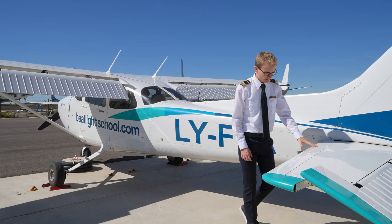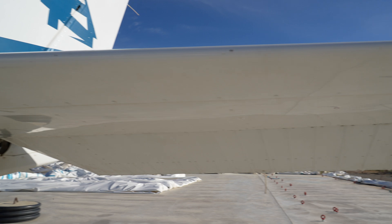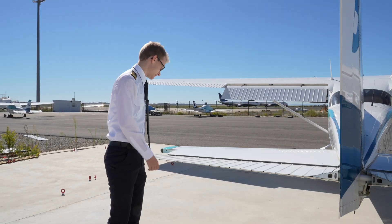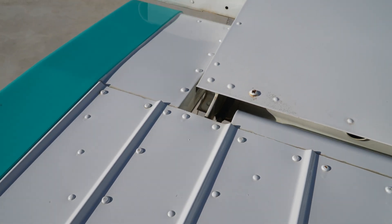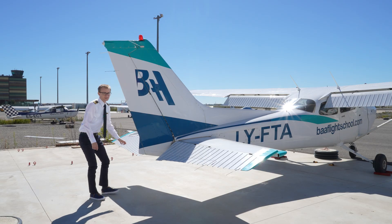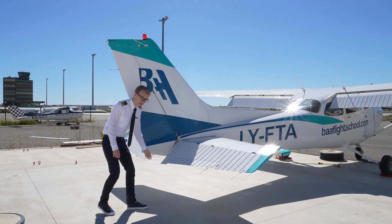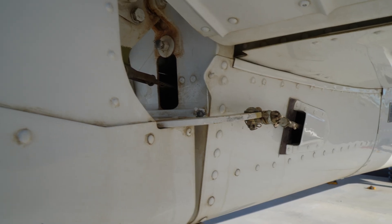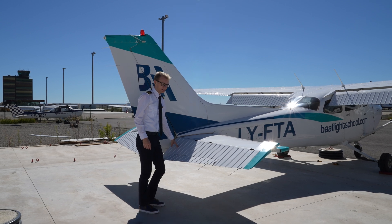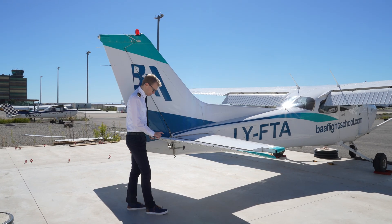We move along and take a look at the upper and lower part of the fuselage, checking for any general damage. We then move along to the horizontal stabilizer, checking both the leading edge, the upper surface, and the lower surface for any signs of damage. We continue on to the elevator, verifying that it moves freely and is securely attached, that the hinges all look good, and also taking a look at the control cable. Next up, we take a look at our vertical stabilizer and rudder, making sure it's securely attached and moves freely, and again checking our control cables. Then on the other side, we also inspect the elevator — making sure it's securely attached, moves freely, and that the linkages look good.